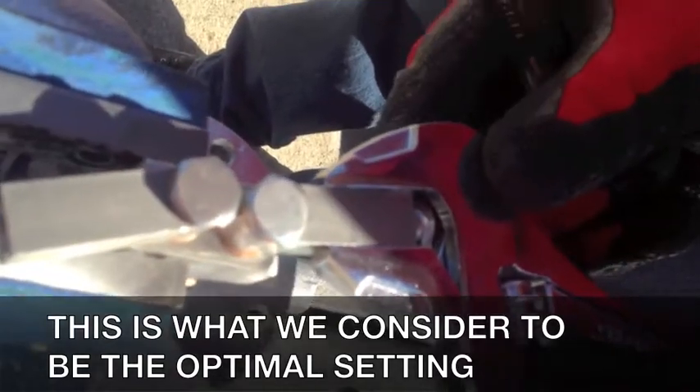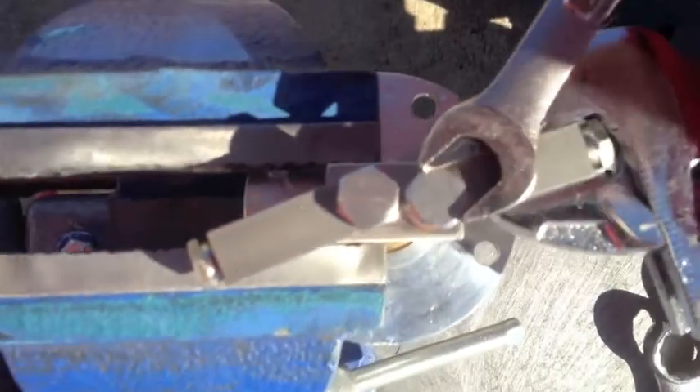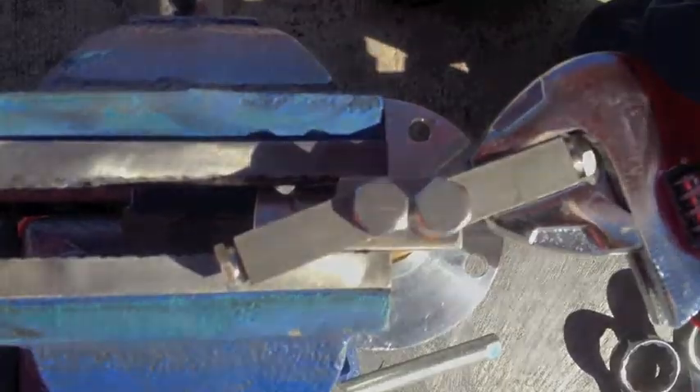I'm going to curl it around to the other side and break that one loose. Hopefully the camera picks that up, but the side of this wash arm goes straight down with the corner of that block. I'm holding it in place, get my 13 millimeter, and just cinch that thing down in place.